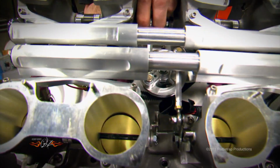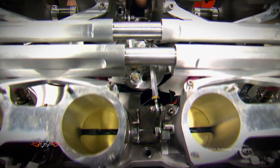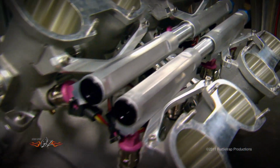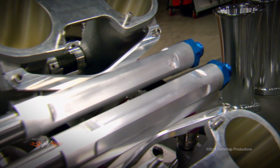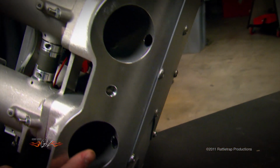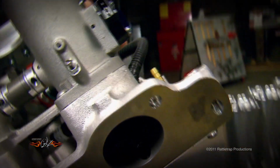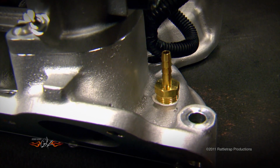visual punch. But if you look a little deeper, you're going to find this is a state-of-the-art electronic fuel injection. The fuel rails, the injectors, and the wiring harness are all tucked up nice and neat into the middle of the unit to keep a super clean appearance. The whole bottom, however, is a plenum that connects all the ports to give you a common, reliable vacuum so you can run power brakes and sensors and all the other stuff necessary on a modern street car.